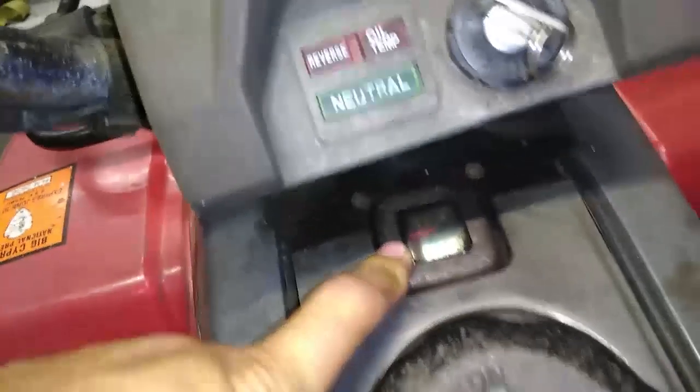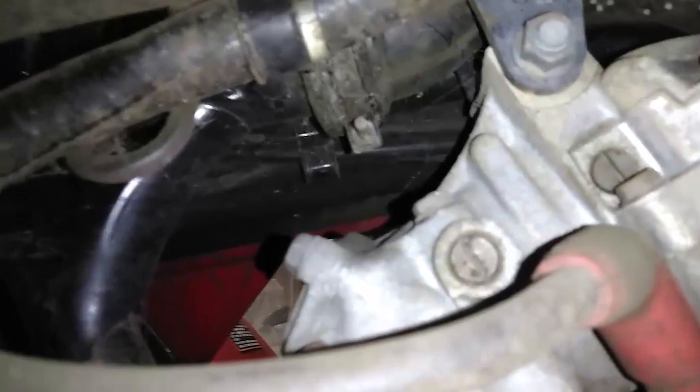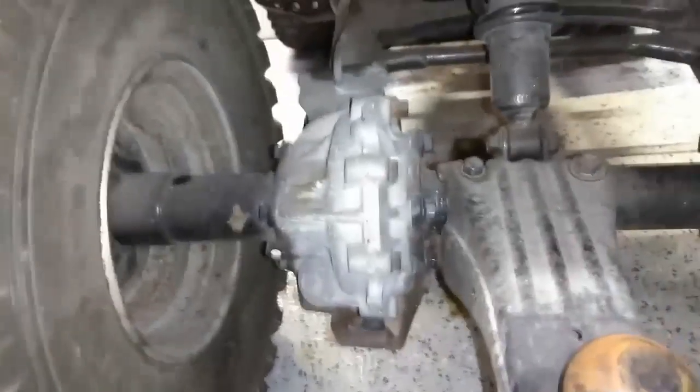You can see the model right there — 1986. It's got a little brake distributor. The fuse box and everything is up here, which keeps it high and dry. It's got a fuel gauge, which is rare on an old Honda. It has that funky-looking dash, but this is all very 300 Big Red-looking — the frame itself is very Big Red-looking too, with one big tube coming down. You can see the carburetor always needs to be rebuilt — look how wet that thing is, just dripping with gas. The air intake breathes through the frame. Also, I was looking for a spare rear end for my 300, and this is the same rear end with the same gear ratio. We all know the weak point on the Honda 300 is the rear end, so now I've got a spare rear axle assembly.